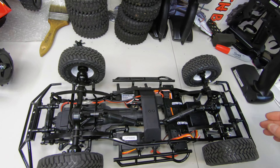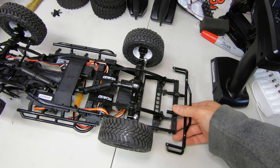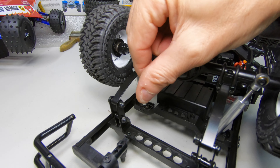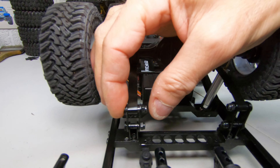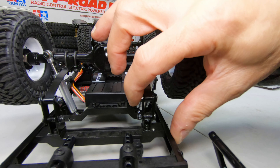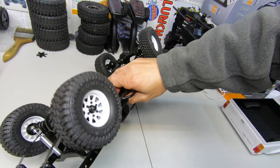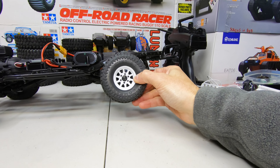Discard the small one out of the front. Then, to make it get a little more flex — you can see it flexes a little bit better. These shackles here: unscrew the nuts until the end of the screw is flush with the end of the nut. That way it'll be loosened up — do that to all of them, everyone on the whole shackles, front and rear. That makes it wiggle like this, and that's what gives you that little extra twist. Plus with the leaf springs — one in the rear and only two in the front — it gets softer, so it flexes better. You can see it's softer and flexes a hell of a lot better.